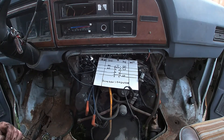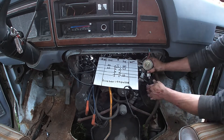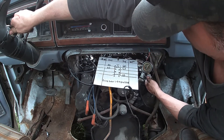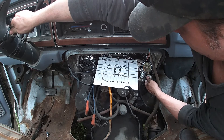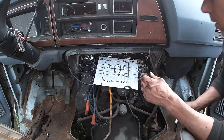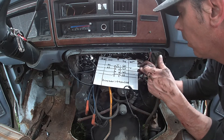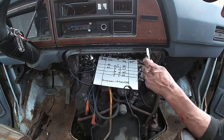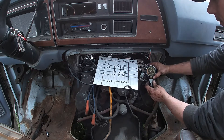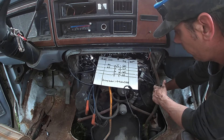So number three — last one on this side. Number three cylinder. That one's another 60. Starting to get a picture here I think. Regardless of the lower numbers, the gauge might be a bit off, but I guarantee it's probably worn out. That one didn't climb very high fast — rings probably on that one, and valves. So that was number three, all that side's done.